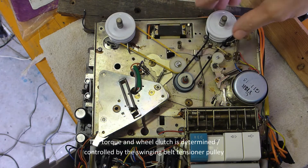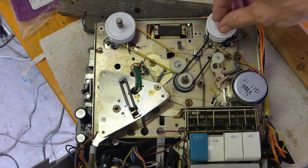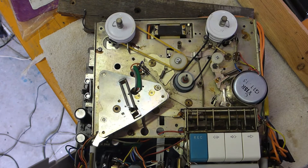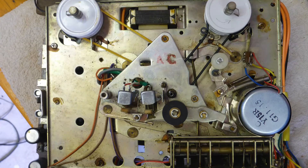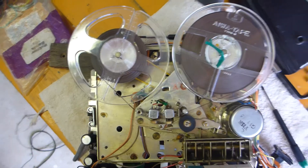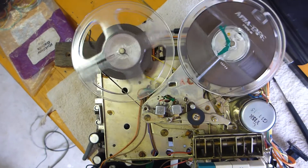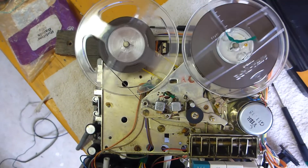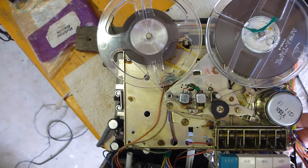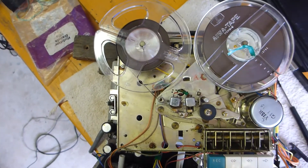The intent is that this capstan wheel physically binds on this belt — I've just used a rubber band because I don't have the right belt yet. The idea is that the torque on this capstan pulley wheel is greater than the torque on this pulley wheel, so this one will actually be spun backwards as it rewinds. These belts were meant to have slip built into them, so using rubber really is a mistake, but it does get me out of trouble. So we've done a quick reassembly — moment of truth. Fast forward works and rewind works. Hooray, success!